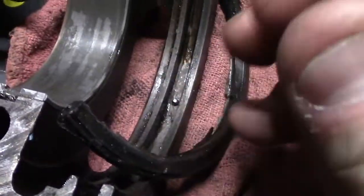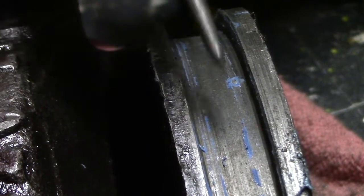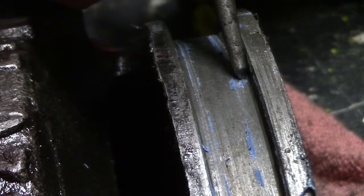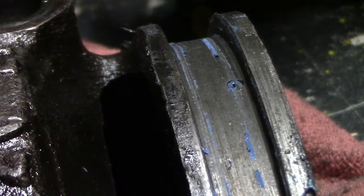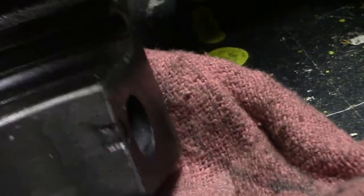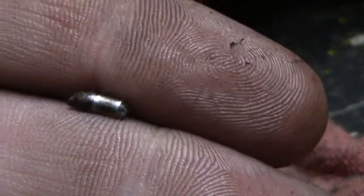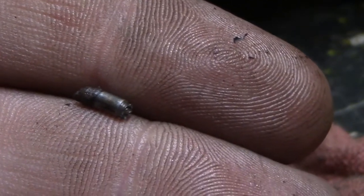I need to remove that pin so I can put in this more modern style rubber and steel rear main seal. You can see the pin from the top of this main cap as well. I'm going to knock it out through the misuse of this ice pick. That went right through. Let's check the other side — there's the pin. Now that's out, my new seal should seat right in there and not misshape and dump oil out the back of my engine all over my transmission.